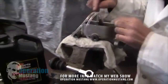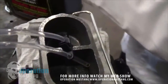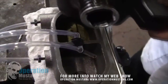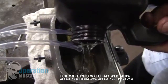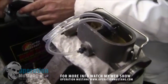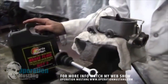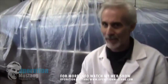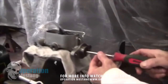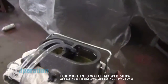Once you've got your setup on there, make sure you have your hoses down deep inside the cylinder itself. Pour some good clean fluid in there. It's really important when you're working with brake fluid not to get it on paint — this stuff will eat your paint up. Also make sure you put the cap on the container because brake fluid will evaporate. If you leave it with the cap off and come back a month from now, half the fluid will be gone.